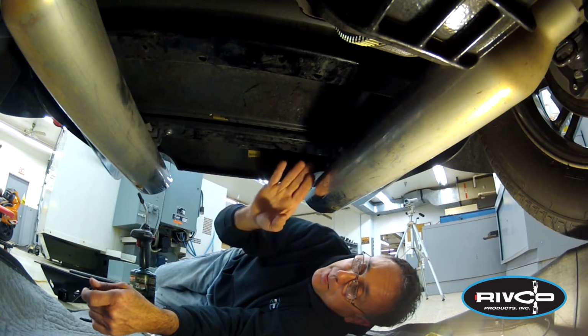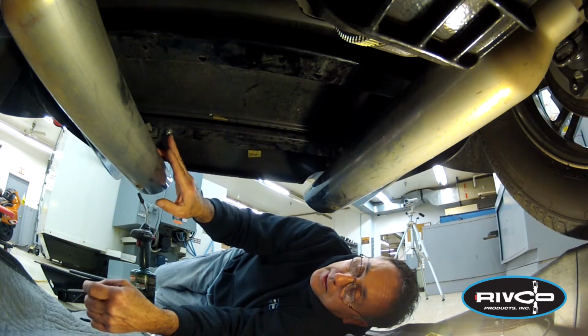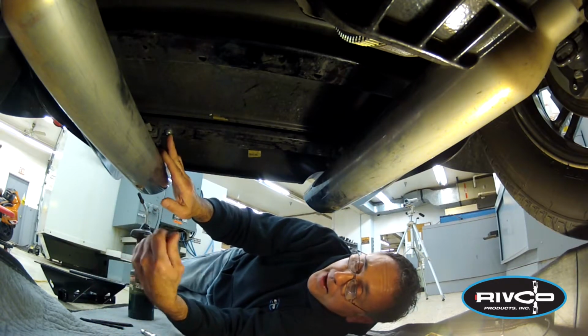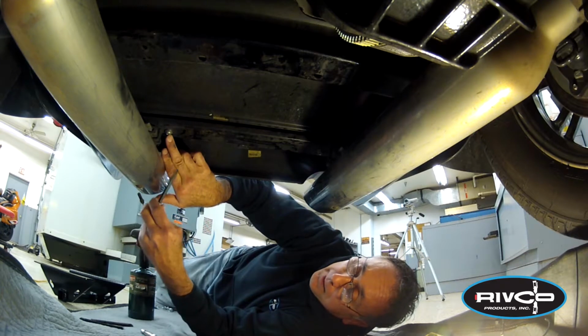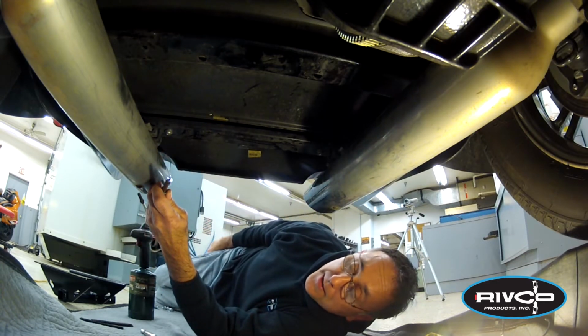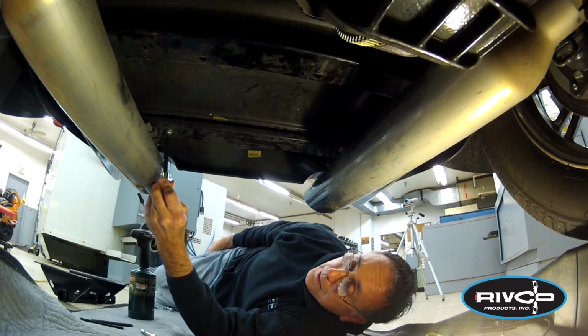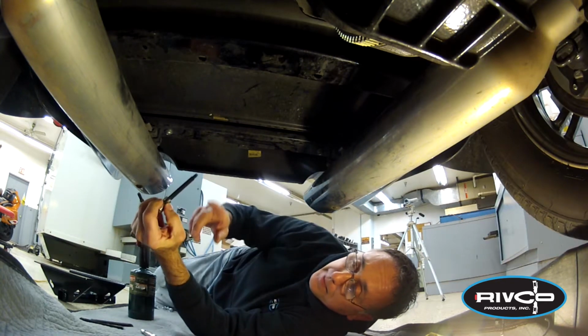And on the rear cross member, you'll notice there's 2 T40 Torx head screws, the ones we talked about earlier with the tamper-proof head. Those have a little pin sticking out of the middle of them. You'll need a wrench that has that hole in the center of it. I like to use the long socket, as you can see, that gets by alongside the muffler. That, or you can buy the L-type Allen wrench sort.